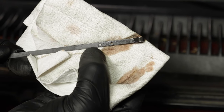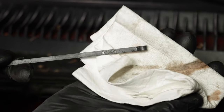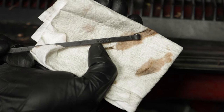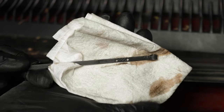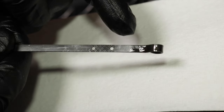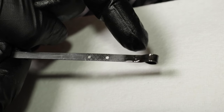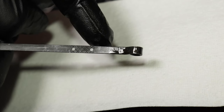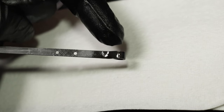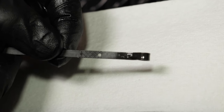When your vehicle is warm, you definitely don't want your transmission fluid above the top dot or not even registering on the dipstick at all. If you pull out your transmission dipstick and it looks dry with the vehicle running, your transmission fluid is super low. Looking at our actual dipstick now, I don't see fluid in the safe range. Moving down, there's a minute amount of fluid here, but it's very minimal. Down further it's extra thick, which tells me that's approximately where the level is — and if the fluid's down there when it should be up in the safe range, you're going to notice those symptoms I talked about.